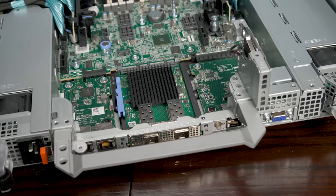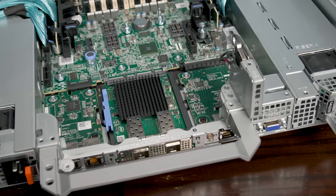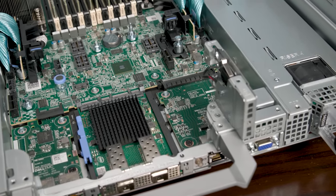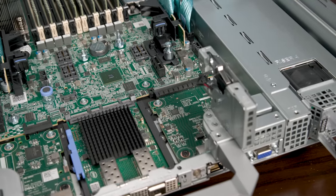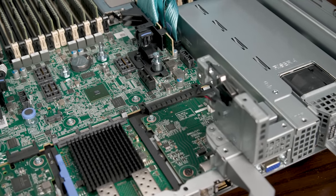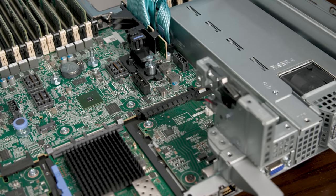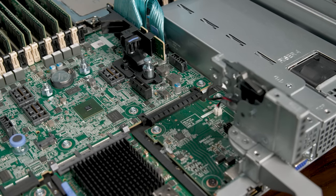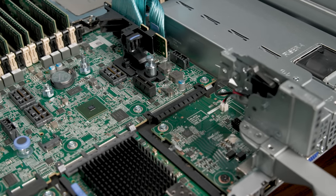Where this gets really interesting is the back portion of the motherboard, because there is no rear I/O on the motherboard itself. Instead, there are a total of three slots on the back. On the rear connectors, we get one that's base networking — in this system, dual-port 1 GbE based on Broadcom. On the other side, a card with features like VGA port and chassis intrusion — all those base motherboard I/O features happen there.